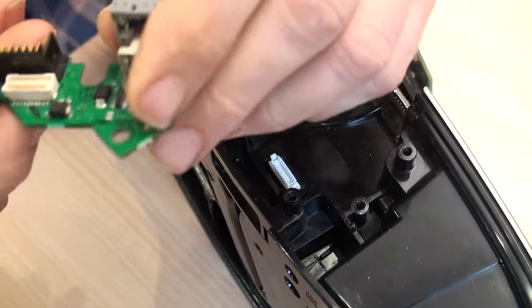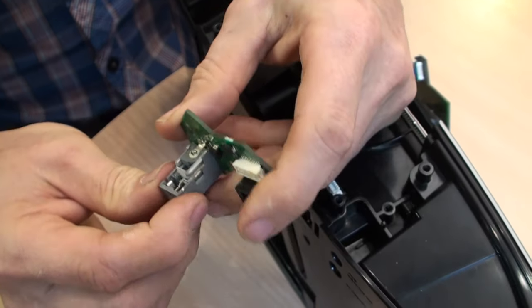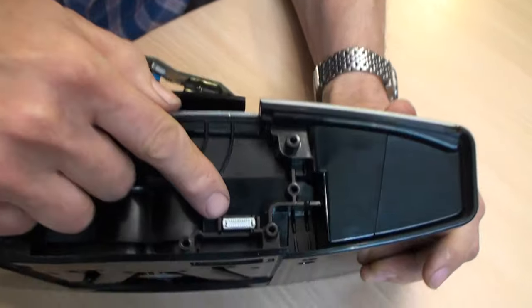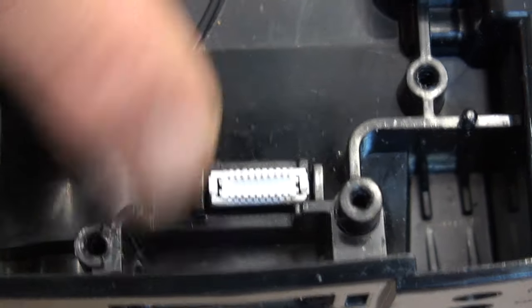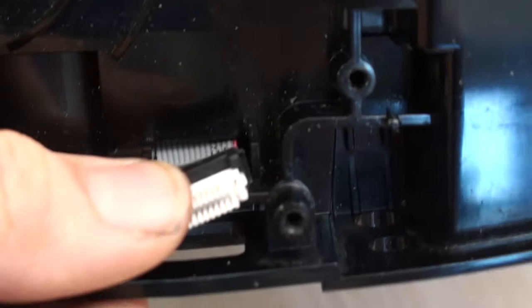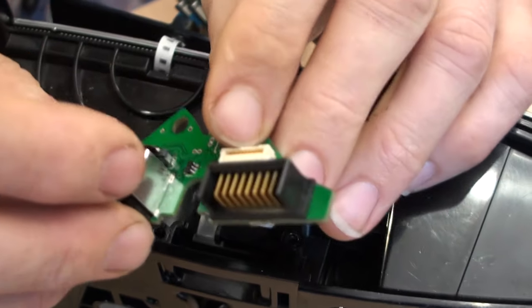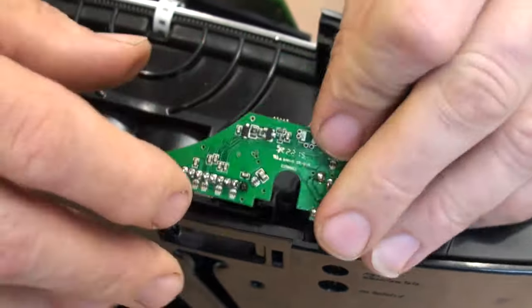By gently lifting the board up it'll come unplugged. There's the old board with its plastic connector and the arrangement of contacts that fails. Set it aside for the bin. You can now see the main umbilical connector — the power and audio cable from the dock. Pull it up slightly to get a little extra cable out — maybe 10 millimeters — and then plug it fully into the socket on the new board with a snap. Ensure it is fully plugged in; if it isn't fully plugged in, it won't work.